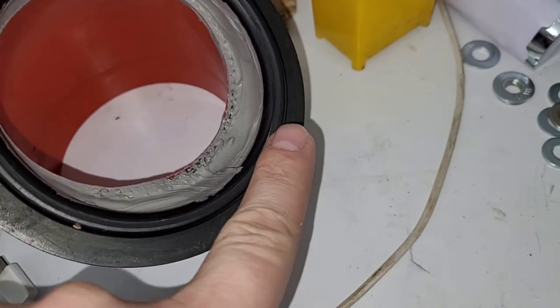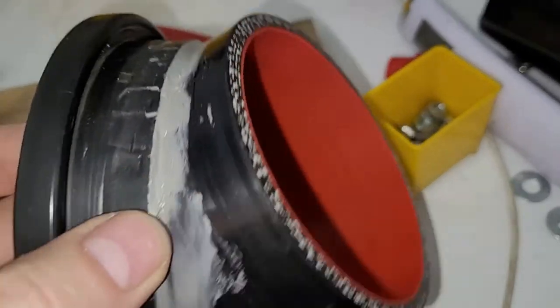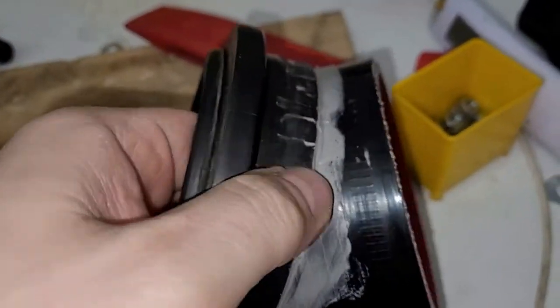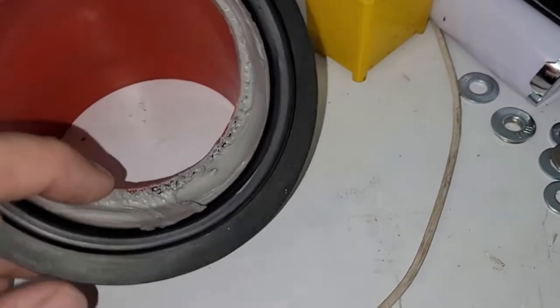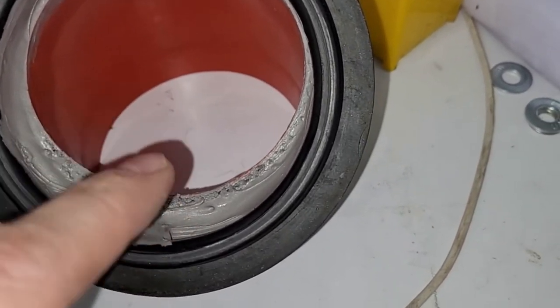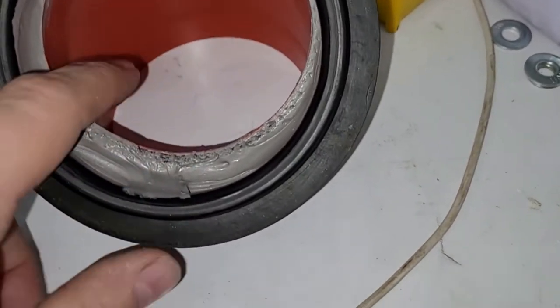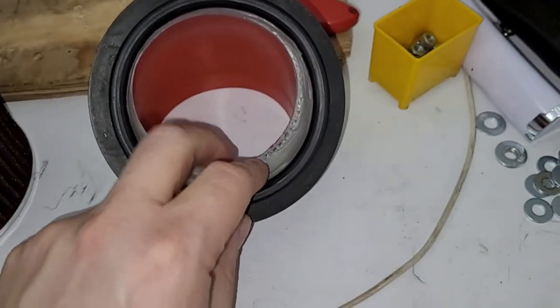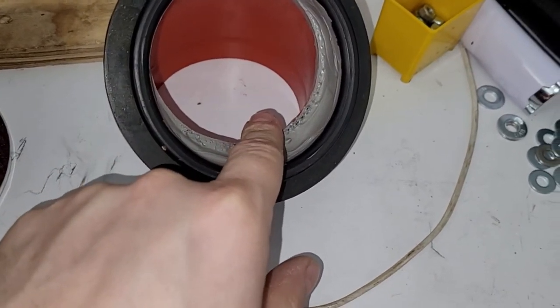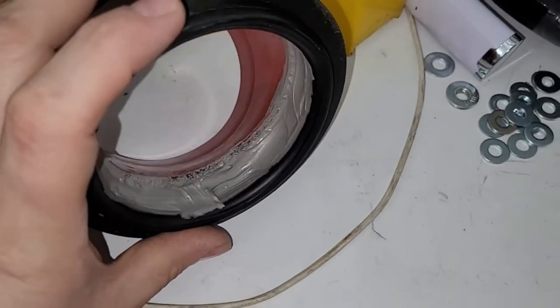So flow that's coming in from the filter just runs into that wall. Now, when I did this, I filled all of this. This is 100% filled. This is like a big block of rubber, plastic, RTV, whatever. This stuff cures fairly hard. So what we're gonna attempt is, I've got a finger sander now. I'm gonna go put some coarse sandpaper on and see if I can go in here and radius this, because I've got material under this, so there's room to work with. And if I can sand this, which I think I can, I don't know, maybe I can, that means I'll be able to radius this, and that'll help the flow.